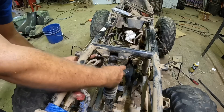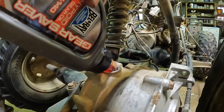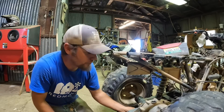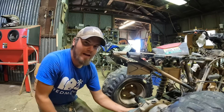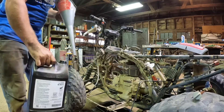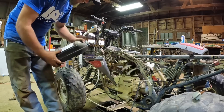When I had the rear end off I accidentally dumped all of the gear oil out of the differential, so I'm going to fill that up right now while I'm thinking about it because it would be a really easy thing to forget. The way the rear ends are on these four-wheelers, they don't have a dipstick — they just have a check hole. When you're filling it, you take the check hole bolt out and when oil starts coming out of that hole you know it's full. I also had to drain the engine oil to get that case off, so I'm filling that back up now as well.